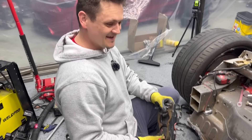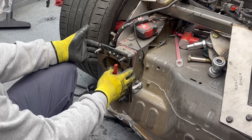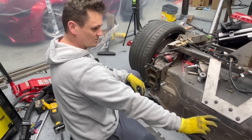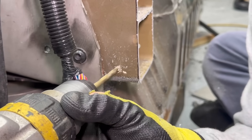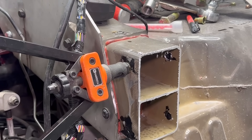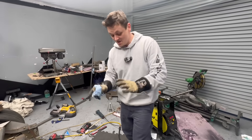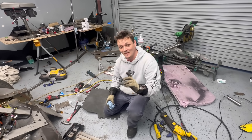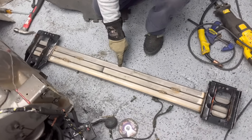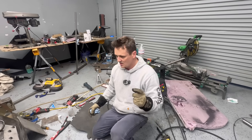Next step, I gotta take a look at how stubby the rear end is gonna be. These are the original brackets — metal onto aluminum. I'm gonna make my own bumper here that's gonna consist of stainless steel. This is my bumper using straight one-and-a-half by one-and-a-half stainless steel 316 square tubing. I stacked three of them together, welded them to the original brackets. From then on, it's gonna be bolted on and then using panel adhesive.